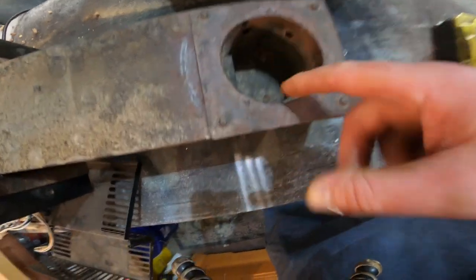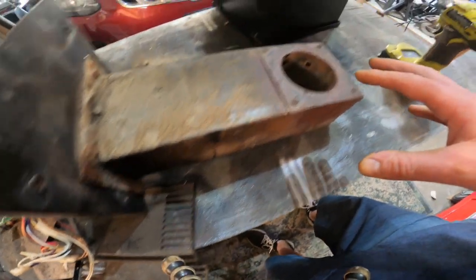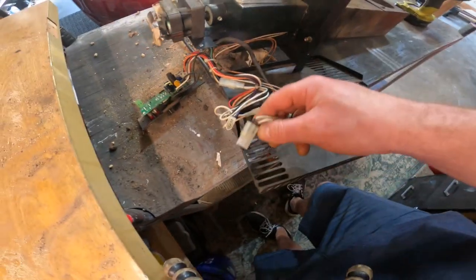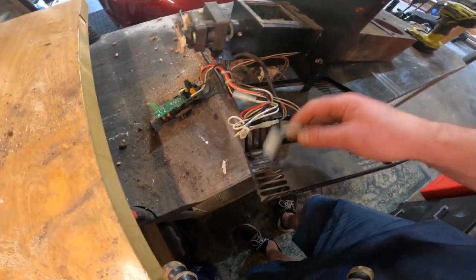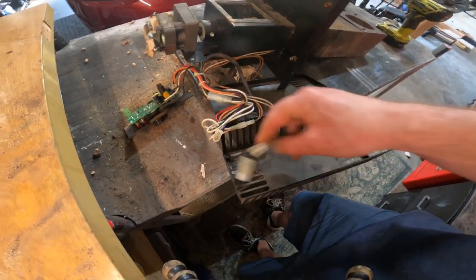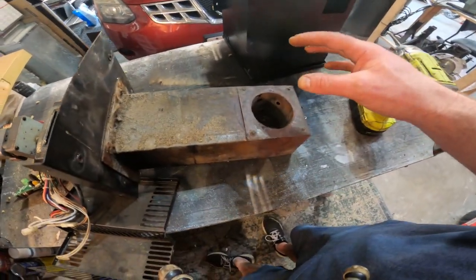This box has a lot of rust holes in it, so I'll probably order that and a heat rod at the same time, then put it all back together and test it out. The other way to do this without taking it apart like I have is to unplug the components one at a time while the unit's plugged into the wall and see which one doesn't pop the breaker. If you unplug the heat rod and run it and nothing happens, then you know the heat rod's the problem. If it still pops, plug it back in and try unplugging the auger. Just process of elimination.